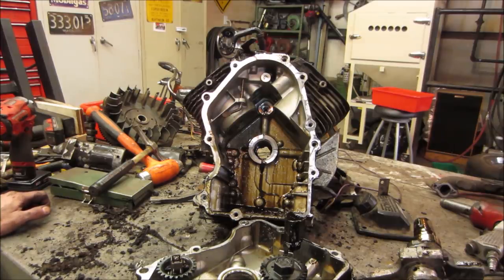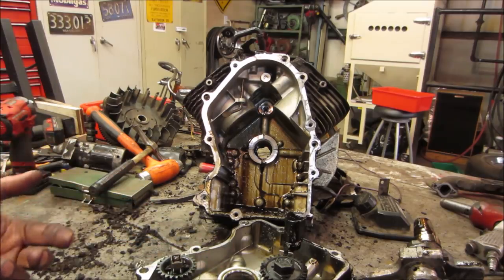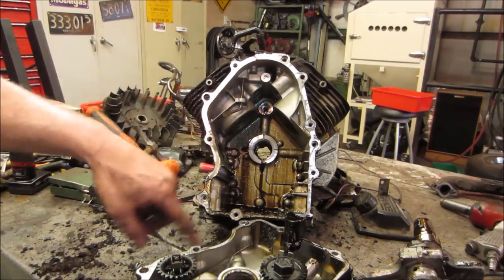But by the same token on the other end, when you go to put a load on it, and say you're holding it at 3,600 RPM, you're holding the gas pedal down an eighth of an inch, an eighth of the way to maintain that RPM. And as soon as you turn the mower deck on or drive the mower deck into thick grass and it puts a load on it, RPMs are just going to come right down. And there's got to be some way for the throttle to come back and adjust for that to maintain that 3,600 RPM. So that's what this whole system does.